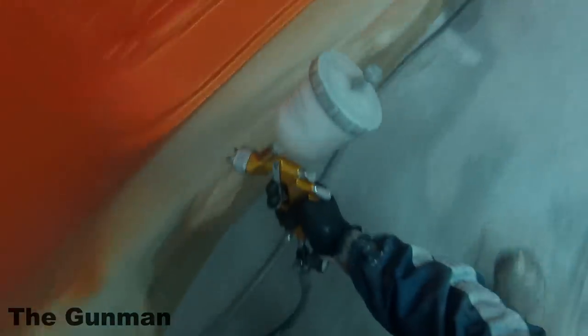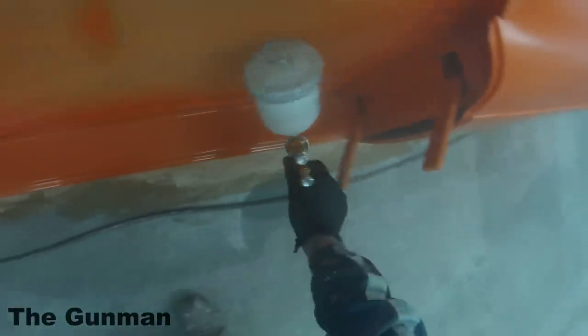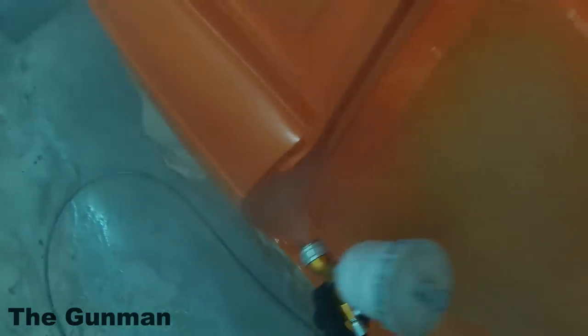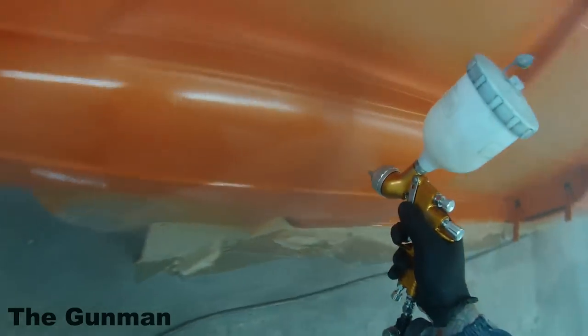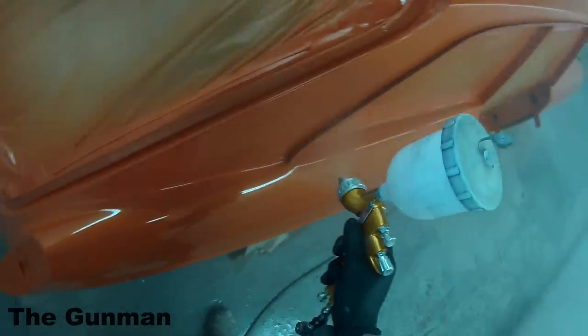I'm finishing off with a demo on an MGB GT — a bigger area to actually paint, so it's more of a real demonstration. This is conventional gun using high solids clear. If you're using medium solids clear it's going to be a lot thinner, so it'll come out quicker — you may need to speed up a touch or hold the gun slightly further back. I like to drop my pressures down when painting flat surfaces like a roof, so I'll get a bit more material on there and it'll flow out. Reducers and hardeners also play a part in this.